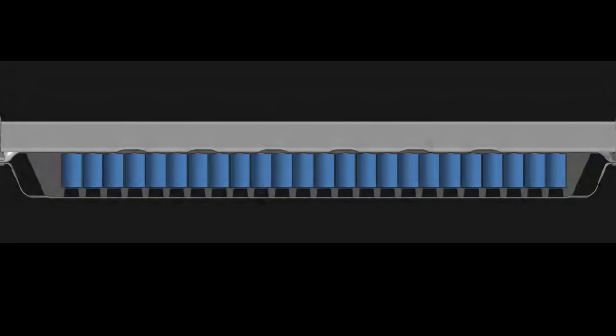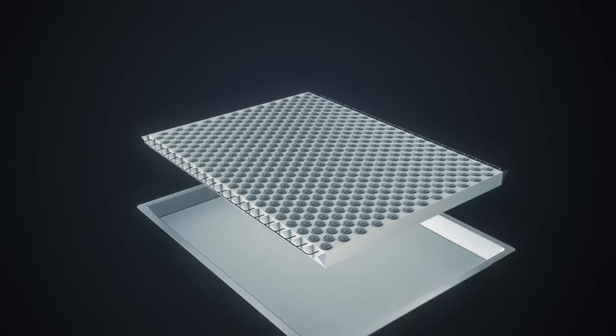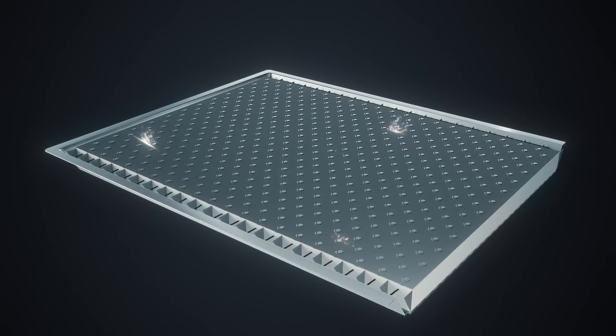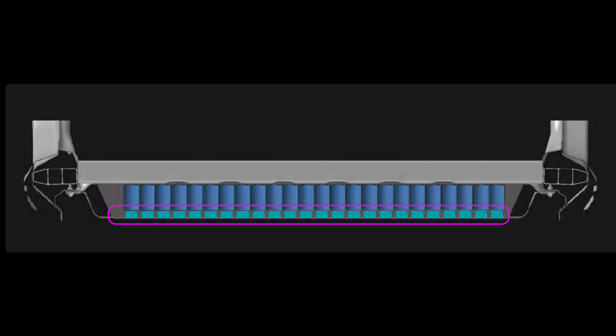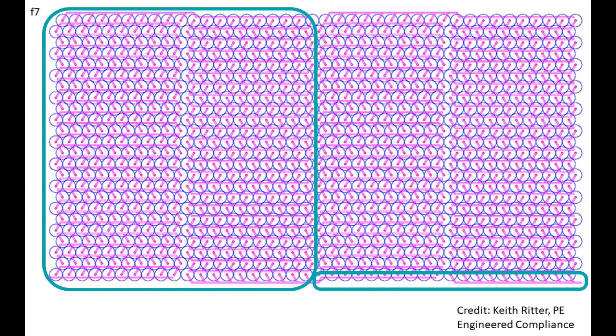It's also a strange coincidence and structurally it makes sense to use an inverted triangle here. The Electrek article stated that the black tubing in this image would be coolant loops, but I don't buy that analysis — I think it's actually wiring. First, my view is that the cells would be inserted skirt-up and the assembly flipped over, putting the wiring at the top, closer to the rest of the vehicle wiring. Second, given that the coolant channels appear to run lengthwise, it would make more sense to connect them at the front and rear of the pack. Wires, on the other hand, need to be wired in series and parallel, which would require connection points along the sides.